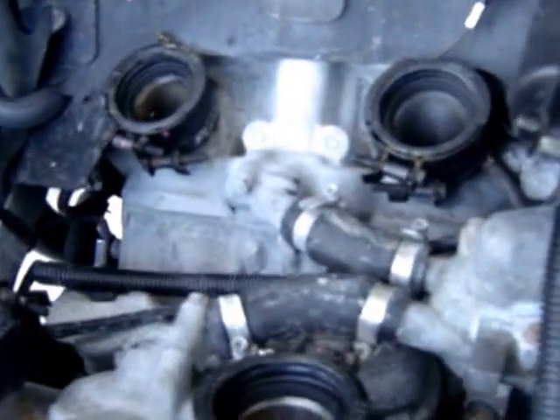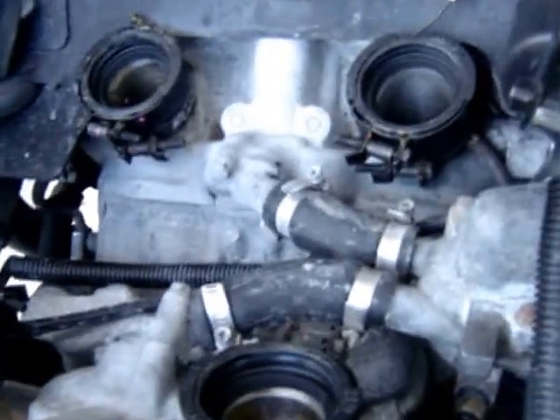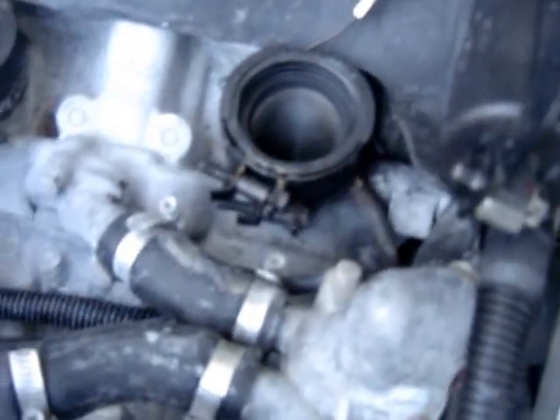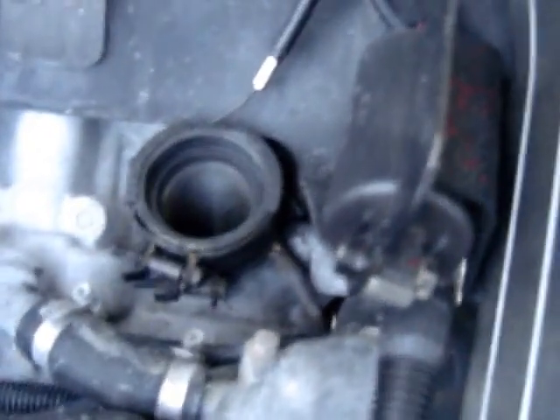I've got to readjust my float needles. I equalized my float needles because I'm having problems syncing my valves — I have a compression or vacuum leak in number three cylinder and number four cylinder. I can only clean three cylinders at a time.